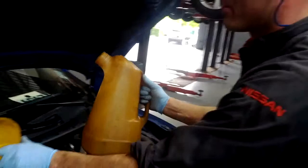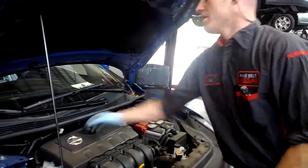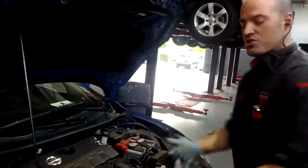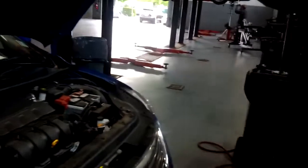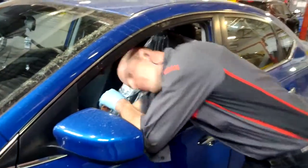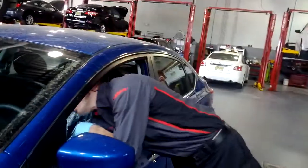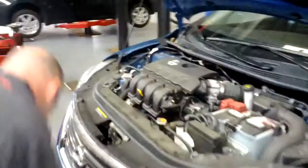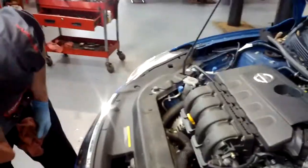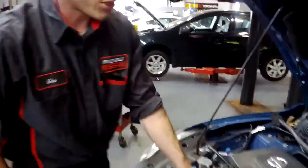Alright, I'm going to stop right there — try that for a second. Remember, you've got to put your oil cap on if you're going to start the car because it could splash. Start the car and let it run for about 10 seconds, then shut it down. That let the oil cycle — it went through the new filter. Let's check the level.